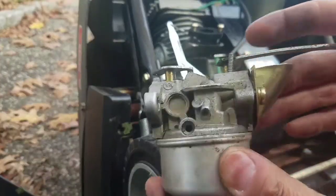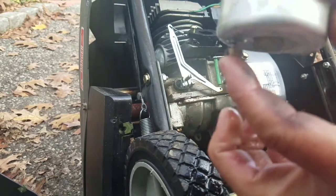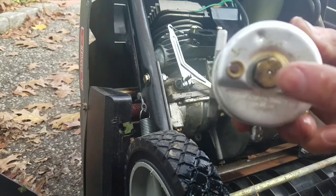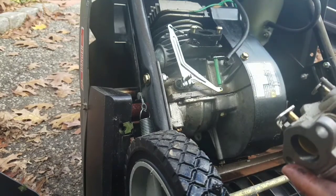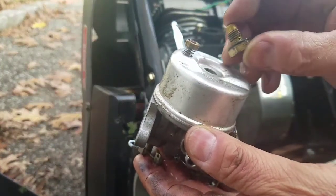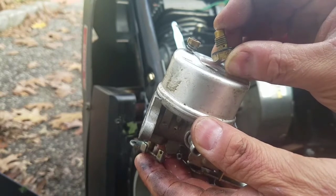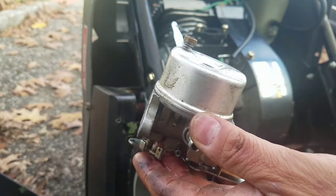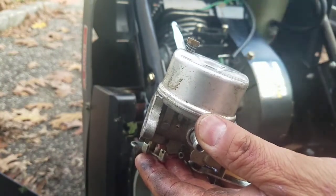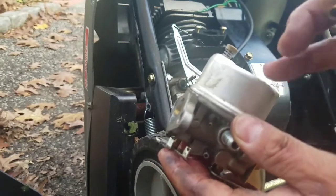So this carburetor is your typical carburetor, and this is a choke. This button here releases fuel in the bowl. See? So you know that there's a lot of fuel in the bowl. I'm going to remove this screw and see what's inside. I just removed the bowl nut, and there's a little hole in it, and you're supposed to see right through it. I can, but it still looks a little dirty. You can see that there's residue there. But I can see through it, which is why we did get the start, but it doesn't look completely clean. We'll take this bowl off now.